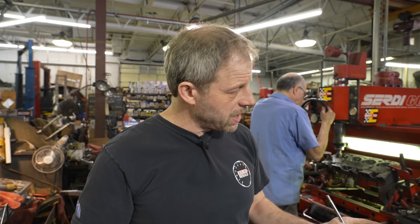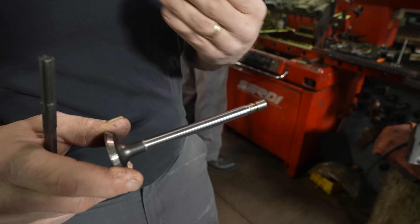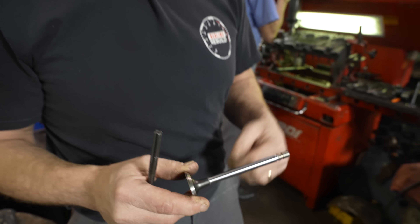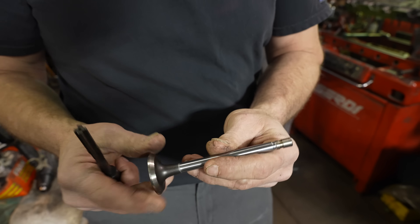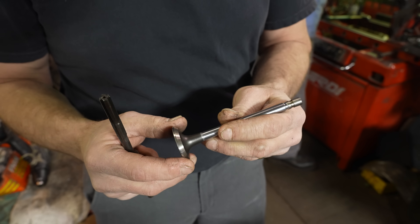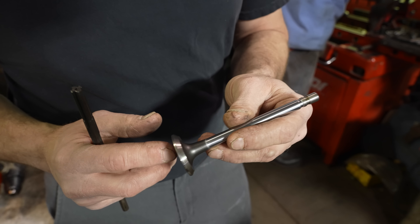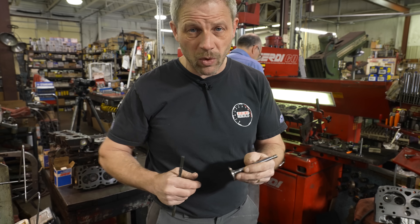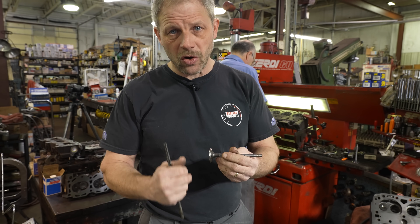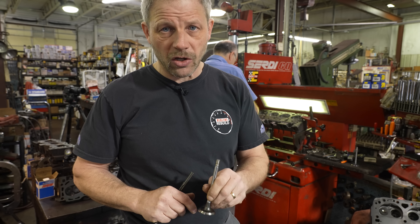Mark's going through and doing all the work on the pair of heads. What we're doing is putting in fresh valves on both sides, cleaning up the guides, and putting in fresh hardened seats on the exhaust side so we can use unleaded gas. On the intakes we're just going to clean up the seat. Now technically these aftermarket valves are larger on the seat size — about 30 thousandths larger. We're not going to oversize the valves to what we call a 305 valve, which would be about a 1.84 inch on the intake opposed to the 1.72s. We're going to stick with the smaller one — this will actually be a 1.750. So we get a little more valve but we keep our low-end torque. We're also going to clean up the backside of the valves and put a 30-degree back-cut on here, which will help on our low-lift flow — that helps torque and street performance.